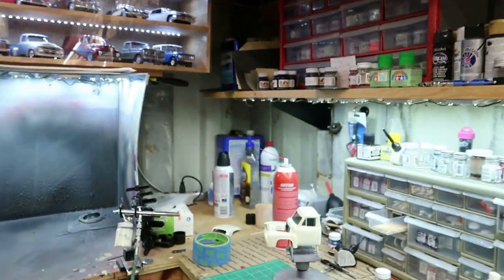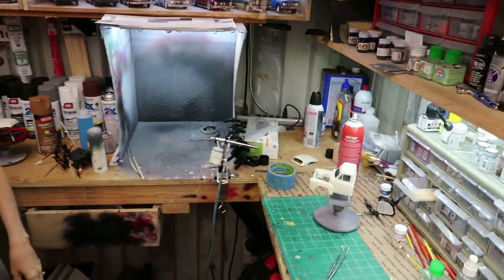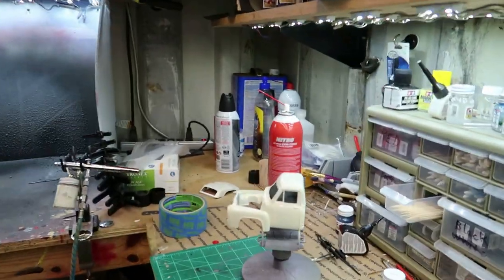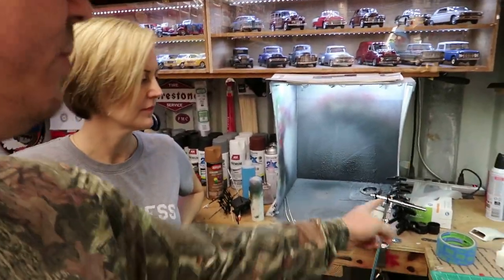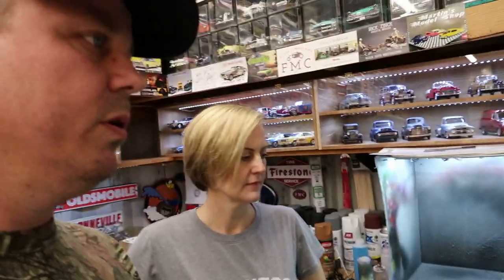So David Chen saved her lungs. Thanks, David. So it turned out real nice. This is a first coat, so they have to have a second coat. And the reason being is the gray primer is a little too dark for us using such a light color. So a lot of your edges will show through. I did go and add a touch more just full strength paint to our mix, so that helped, I think, on the body and on the hood. But we're going to let that tack up. May give it a second coat depending on what it looks like, and see you here in a bit. Thanks for watching.